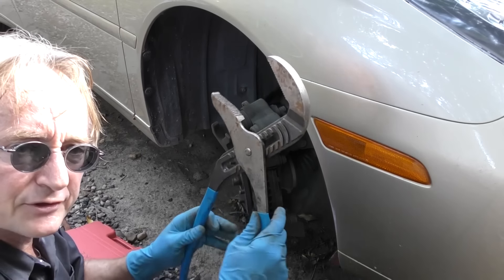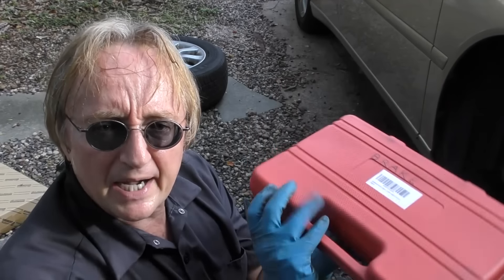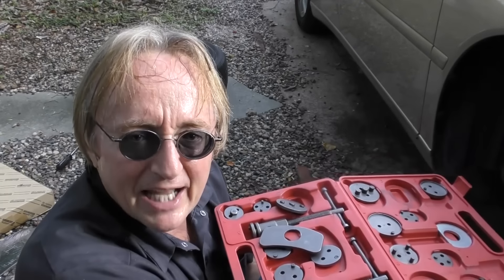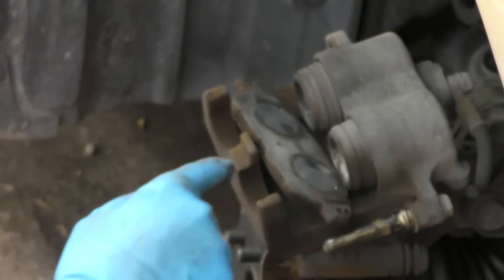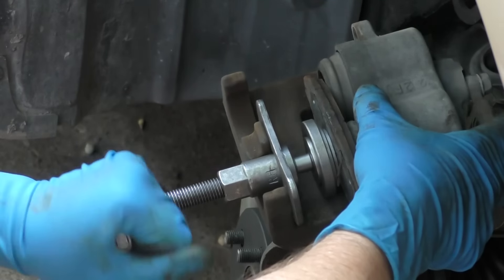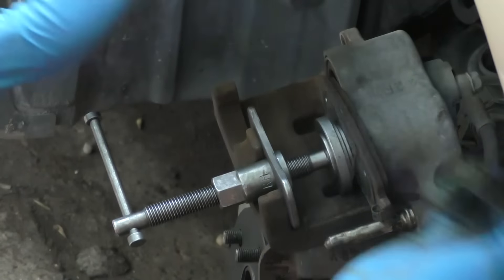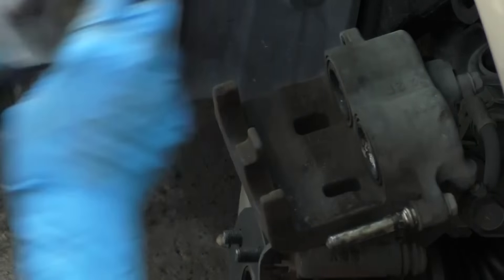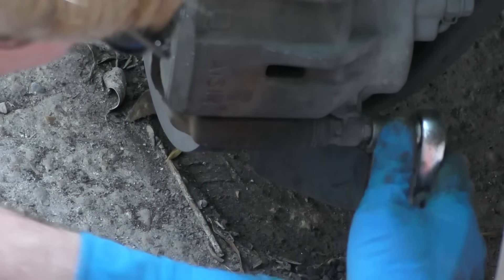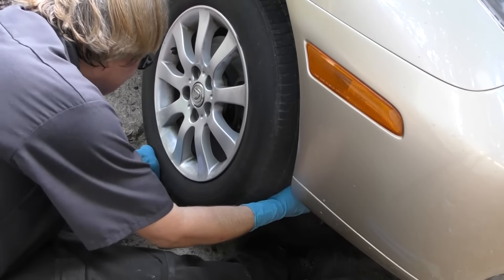Now you have to squeeze the calipers back in. A lot of guys will use a giant pair of pliers, but you can have problems if you squeeze them in too fast — it can mess with your ABS system or ruin your brake master cylinder. So instead I use a brake caliper retractor kit. This thing costs $19 on Amazon, it's all solid steel, and it works great — it will fit any car you're ever going to buy. It's really easy to use: get the device, leave an old brake pad in, slide it on, and then turn the handle to squeeze the calipers back in. As you turn the handle it squeezes the pistons in nice and slowly, so it doesn't do any damage to your system. Once the pistons are flush with the top, you're done — take it out. Then the caliper itself just goes into the hole, slides on, you put the bolt back on, and get your 14mm socket and wrench to get it nice and tight. Then straighten the wheel back up and put the tire back on.